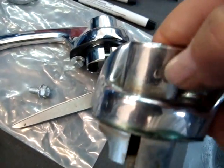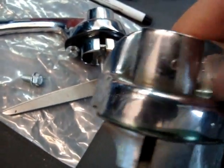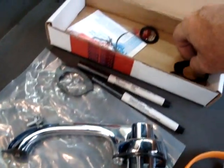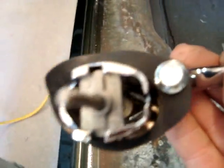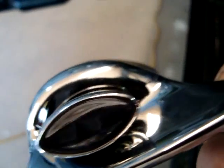When you take these out, the push button comes with them, so you don't want to use this push button on a nice new door handle. Hopefully we won't run into that. The other thing we run into are the gaskets — you'd think they could get these things die-cut right. When you take the gasket and fit it in place, you can see the black rubber gasket on the back held down with the stud. Look at this — that's how much the gasket hangs out around the handle. You can see all that black; it hangs out all the way around.